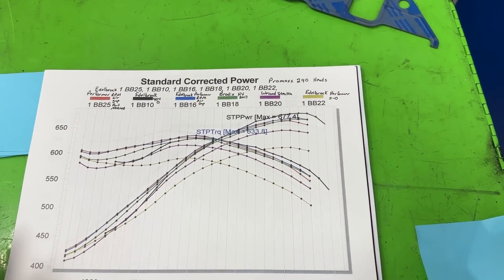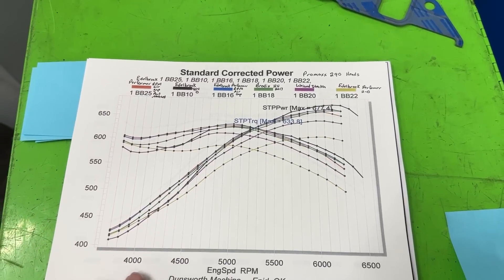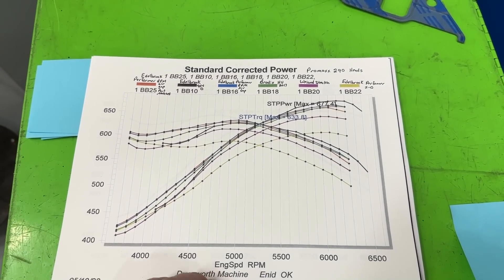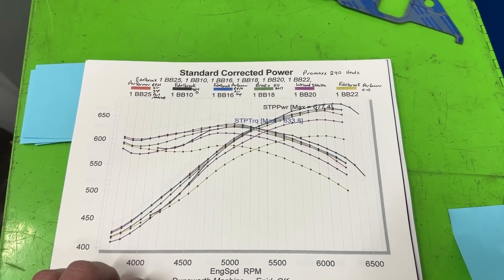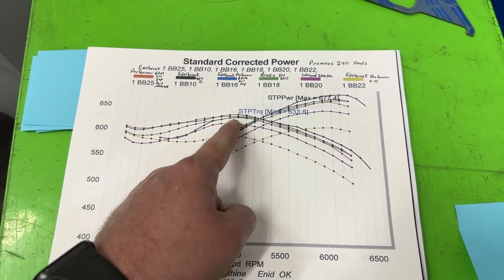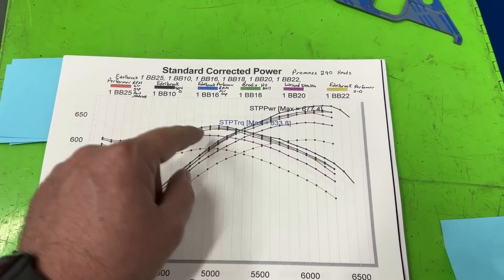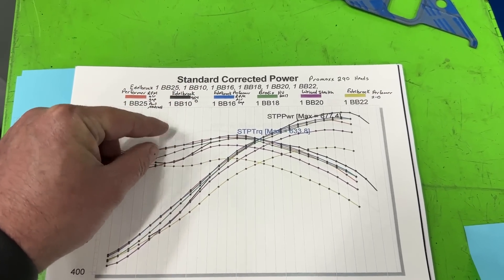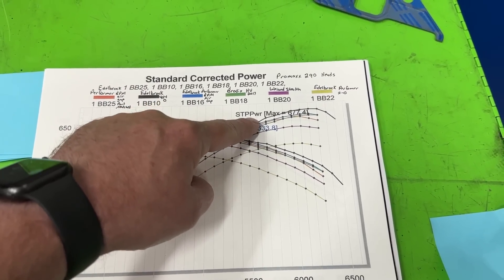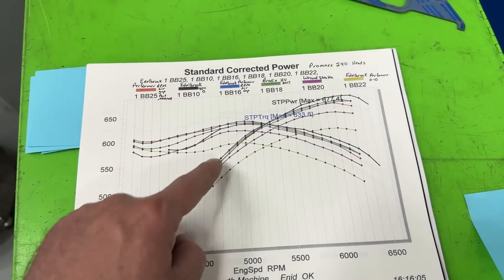I had this other customer who said the 454-Os would be better — and in this case the 454-Rs would be better for a boat engine at 5,400 RPM, but his engine was also a 540. Remember, this engine is only 496. If you put this on a larger engine, this whole RPM band shifts down, so all these gains move lower in the RPM range.